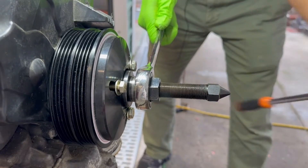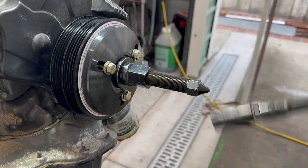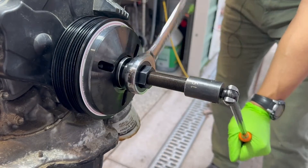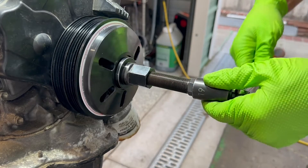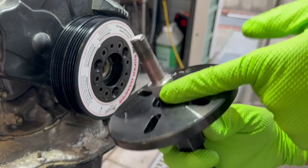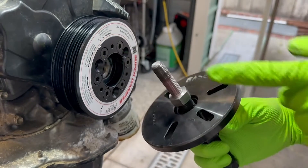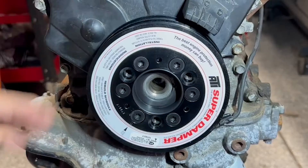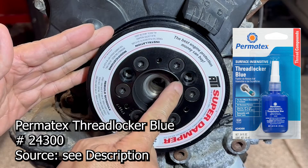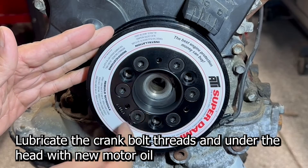And there, she bottomed out. To remove the tool, first remove the base plate by removing the 5/16 inch bolts. Then back out the drive nut just a little, loosen the center shaft and back it out by hand. The crankshaft adapter came out with it — if by chance it is still stuck in the crankshaft, just use a 22mm socket to back it out. To finish the installation, lock the flywheel and then install the three Torx T40 Plus screws with blue Loctite and torque to 16 foot-pounds. Lubricate the crank bolt threads and under the head with new motor oil and torque to the OEM torque spec.